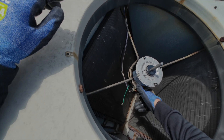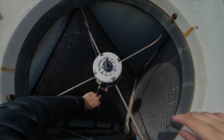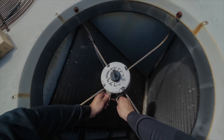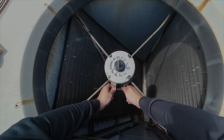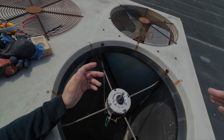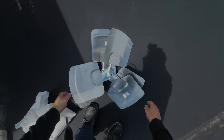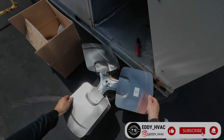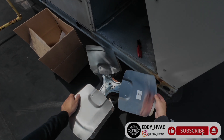Grab your bolt, slide it through like that. I am going to take off my glove for this. Right there — don't drop the nut. Screw it back in and once you get it nice and tight, then you can do that so the blade's not in the way. Then we are going to grab our new fan blade and you are going to see the rotation of it — you can always match it back to the old one, it will be the same thing. Always the nut goes facing up, easy accessible.